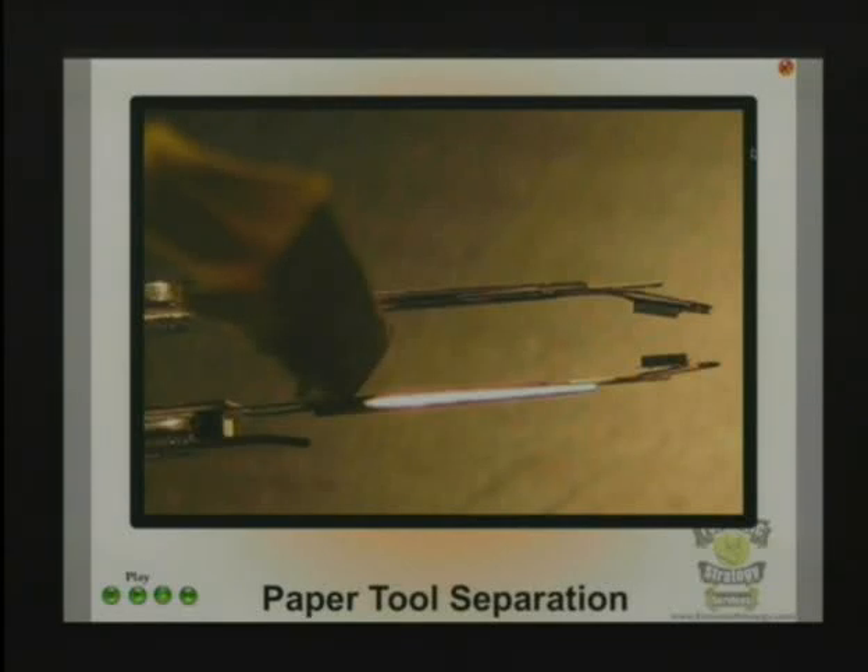This piece right here is typically not actually the head. The head is right here on the very end. They did the same kind of thing that IBM did back in the 50s — they basically put a slider mechanism on here to hold the head, because the head is so small that there's nothing to mount it to. So they've got to do something to give it some support. It mounts on the end of that.